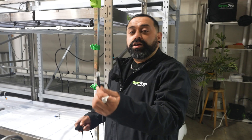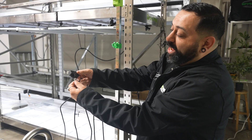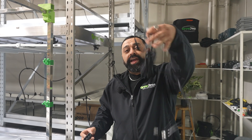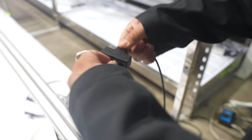For the installation process, you're going to grab your data cord from the actual UCL and connect it into the data splitter, aka the frog. Next, you'll get your Y cord, take the single end, and plug it right into the other side of your data splitter.